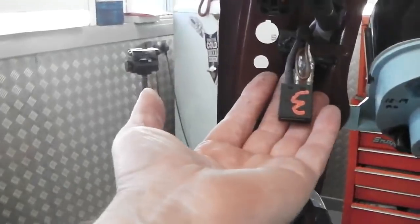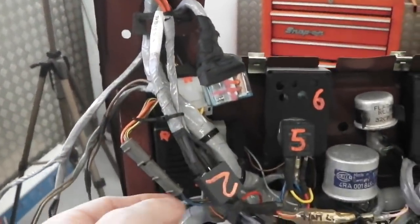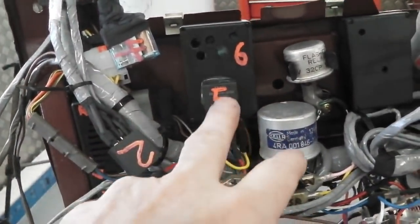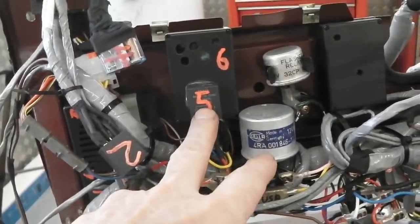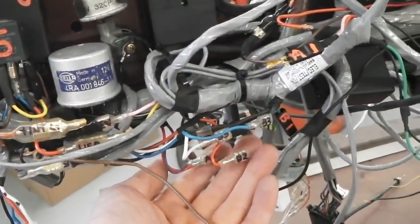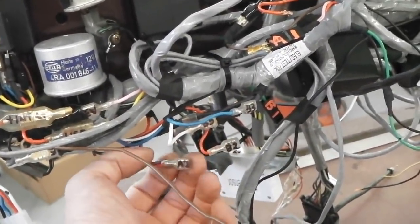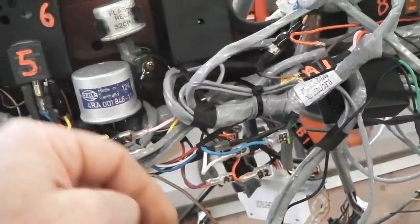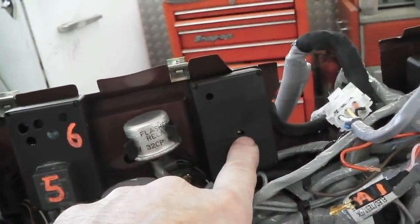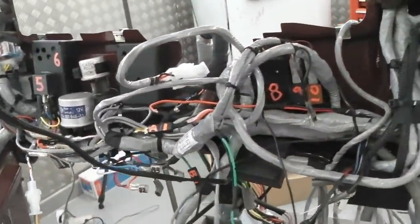Other relays up here, we've got a headlamp override relay, we've got side light override relay, that's the wiper slave, that's the hazard light unit, that's the inverter for the door switches, spare power fuse outlets for anything else. Bluetooth will be using one of these, and then anything else that you can add labelled so you know what fuse it's connected to. That's the auto interior light delay, adjustable with a little screw there. We'll set it probably for 45 seconds. It's set on a minute at the moment.